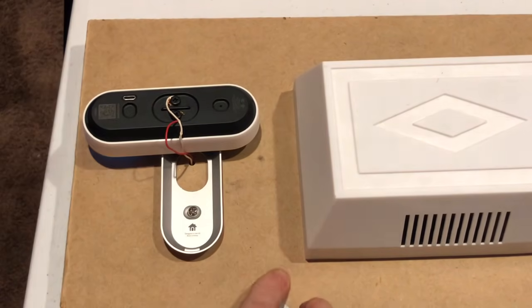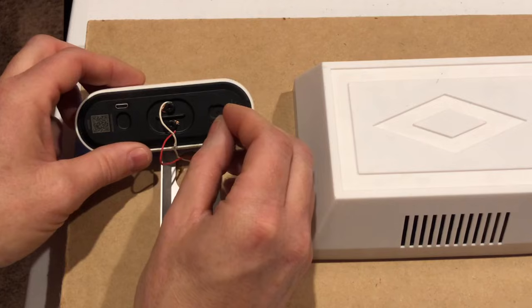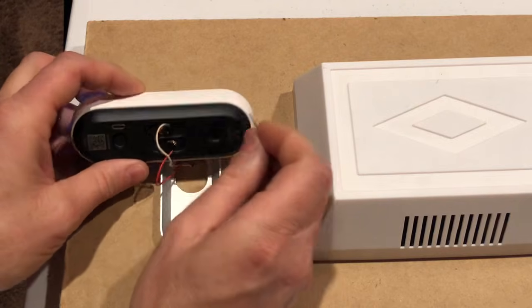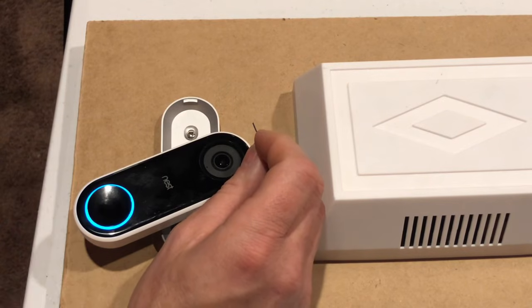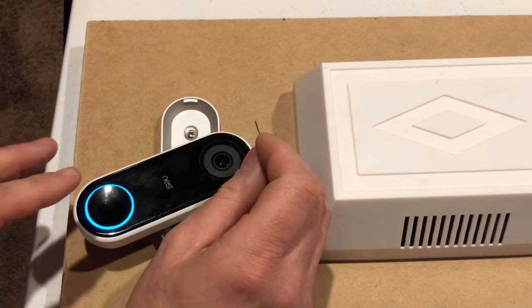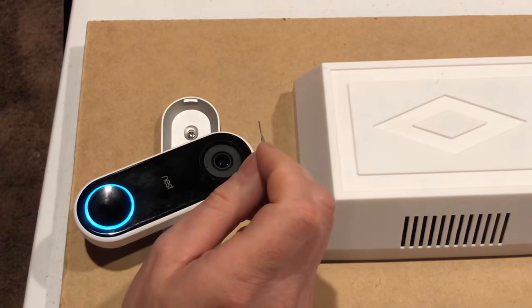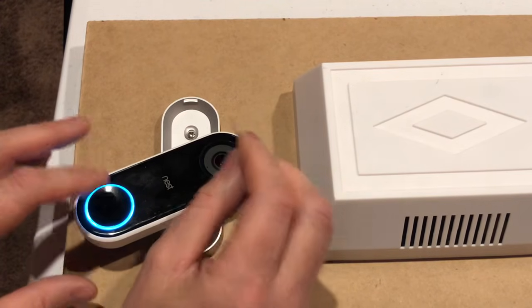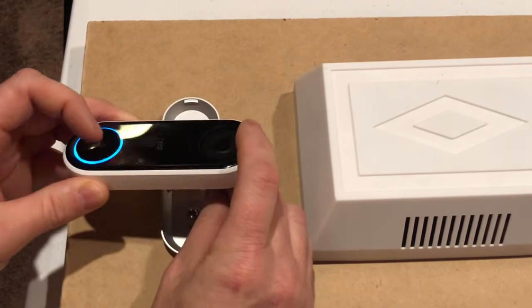Now what we're gonna want to do is stick the removal tool — or your paper clip or pushpin — into this little hole; it's about an inch from the top of the doorbell. We'll stick that in there and we'll hold down on the button on the front, the doorbell button, at the same time. What should happen is we should hear a chime. These rings will go yellow, and then we'll have no power on it at all — it'll all be blank. Then we can let go and remove the tool from the little hole.